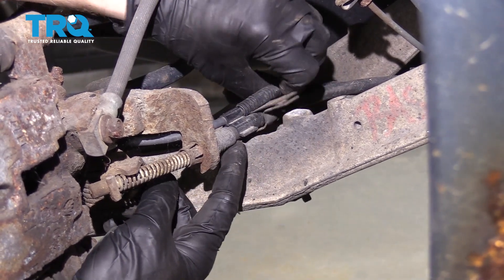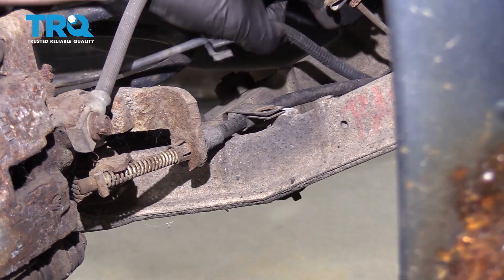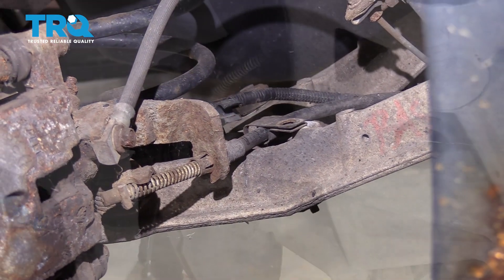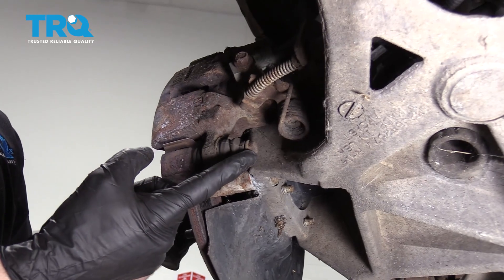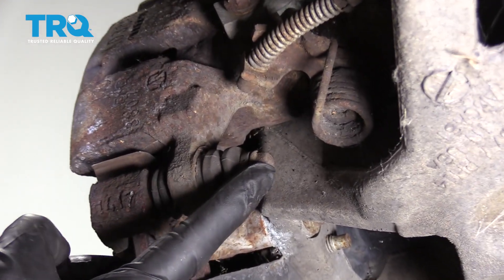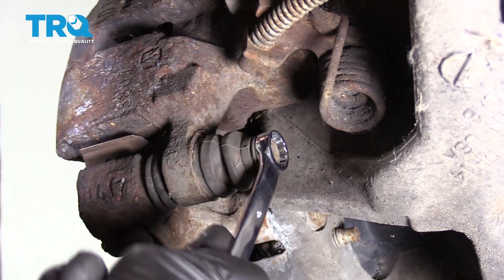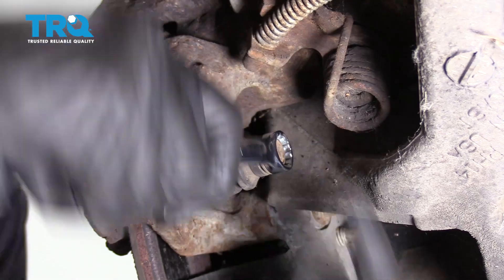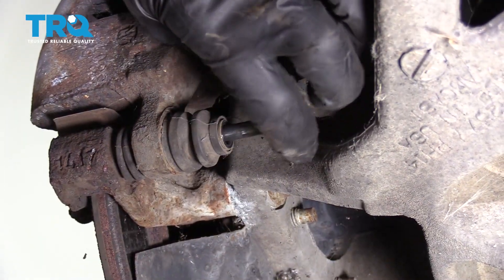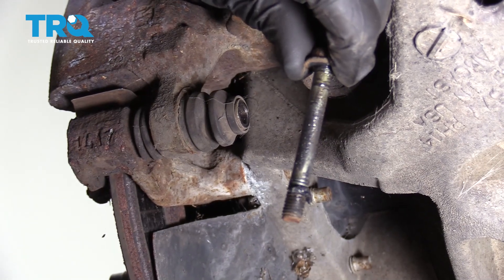This is the area that holds the ABS wire to the e-brake cable. Just go ahead and pop that off so that it has plenty of slack as well. Now let's move along to the backside of the caliper right here. We're going to remove this caliper slider bolt using a 12 millimeter. Go ahead and slide that bolt right out of there, give it a quick inspection, and set it aside.